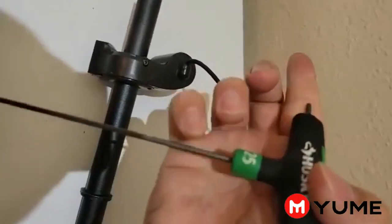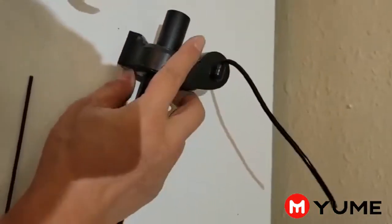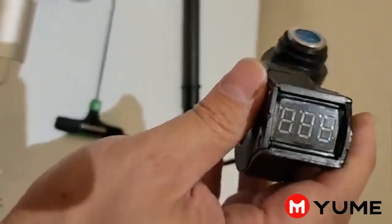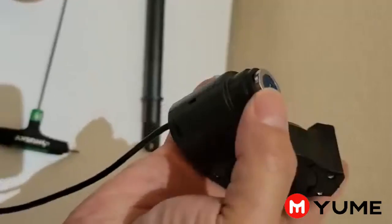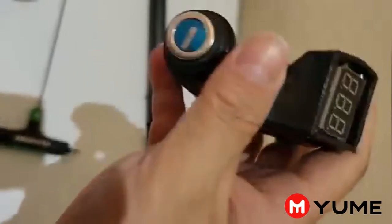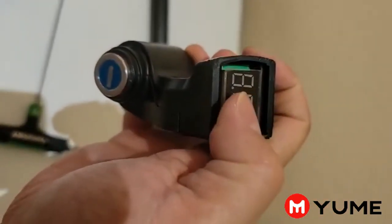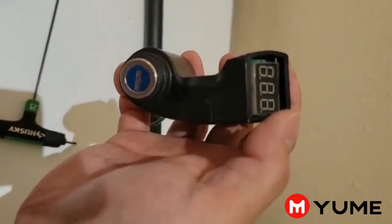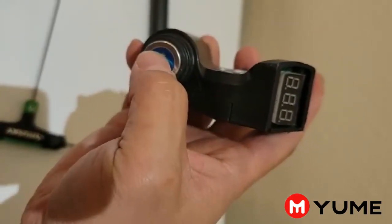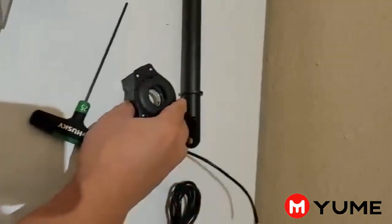To open the key, just use the 2.5mm. Open in here and make them loose, then take it out. All the conditions will be different. But because the key entry in here won't be broken, and sometimes you can break the plastic but inside they're still working. So we're going to keep all the electric parts and the key switch inside — we only change the cover for now.